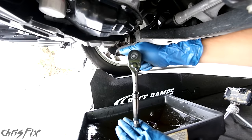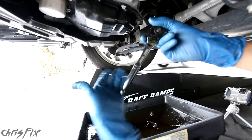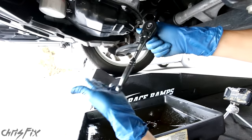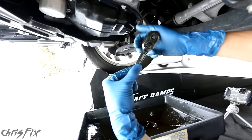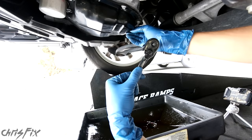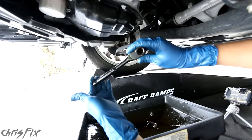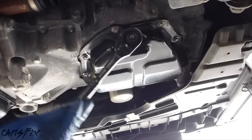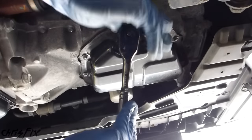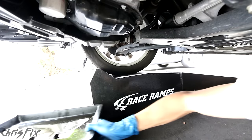The oil is completely drained. Let's screw in the drain plug and move on to the next step. Just screw it in by hand and it should tighten right up. I like to wipe away any extra oil before I tighten it down all the way, so your drain pan stays clean and so you know if there's any oil leaking from the drain plug down the road. To tighten, go clockwise using the small ratchet, not the breaker bar. You're only tightening it until it's snug — you don't want to over-tighten it or you'll strip the drain plug. All you need to do is tighten it to about 20 foot-pounds of torque, then give it a little extra turn. That's it — step one done, removing all the old oil.